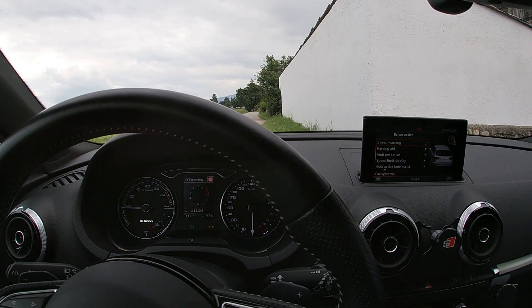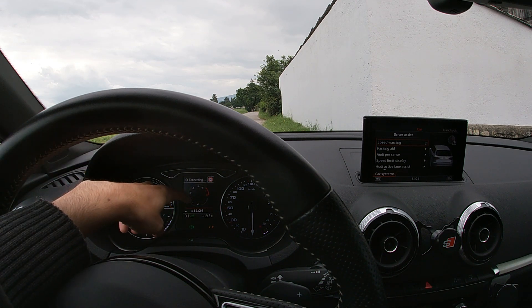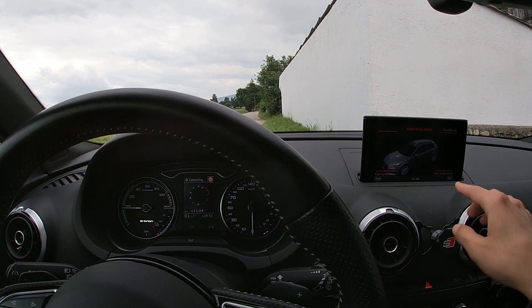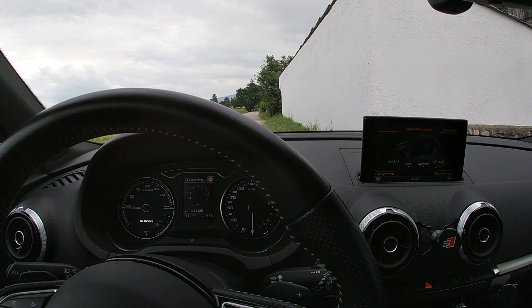Okay, so here we are — the moment of truth. So just to recap: I will be driving in EV mode, I will try to accelerate around 30% on the power bars, and then I will suddenly put it in S mode — sport mode — and release the gas pedal at the same time. You should see the revs going up but steady. The icon of the engine should not turn on. I'm not really sure what you will see on some displays because I don't remember. So the car is cold and we're going to do this test.